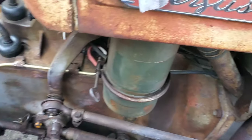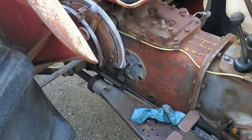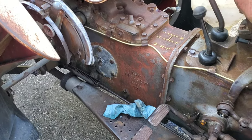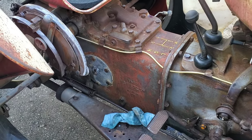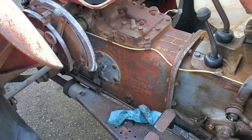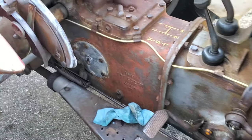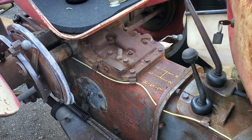I may do a wear check on it. We'll see how it goes. If it's really full of water, after a while we'll just call it an expensive flush. But once you get the water in, it's a tough system. I may put an oil filter on this when we get the hydraulic system on. It's just a valve, and then it ports back through. So what I might do is run it through a water absorbing filter.